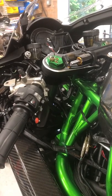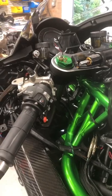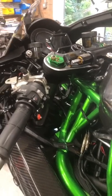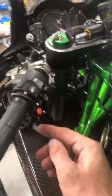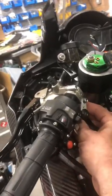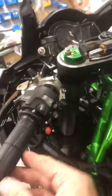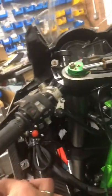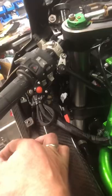Then what we will... I haven't had a chance to test it enough, to be totally honest. I do have a thumb brake that I would like to fit to this, but it's whether I can get it to fit. The thumb brake will have to be mounted from there, and it needs to come out long enough to cope. Now the problem with some of these, when you've got hydraulic clutch things, is the pipes can get in the way, but this one doesn't look too bad. On my ZR40 it's crazy in the way. I might try and fit that once I've got everything off, just to see how it'll go.